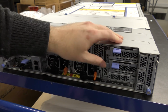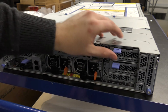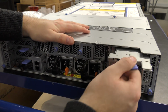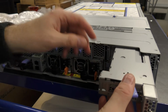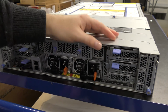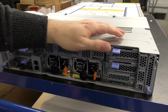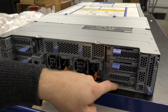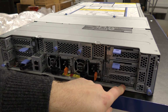These are expansion slots. Each of the servers has an expander card on the back here, and these are not hot pluggable, but to replace one you only need to shut down the server which is going to be using this expansion card. So this could be a very good network card, it could be a little graphics card, it could be a 100 gigabit network card, something that uses a lot of I/O. And these are PCI Express 3 and they're X16, and 75 watts is supplied to the socket.